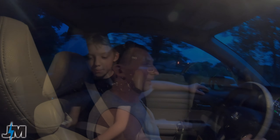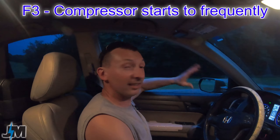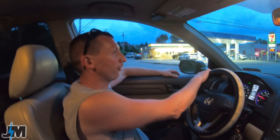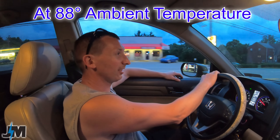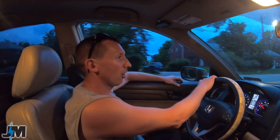We just got back to the car after the race — my son got third place on his first race of the year. The ice cream sandwiches stayed nicely frozen. It's been 3 hours 50 minutes since we left home, with 40 minutes of that plugged into the car, so the battery lasted about three hours standalone. When I got back to the car it showed an F3 error code. The compressor was trying to kick on but couldn't; once I started the car it kicked back on and ran at 91 watts pulling 7 amps. It kept everything cold for about three hours running with one side at 0°F freezer and one side at 35°F fridge.